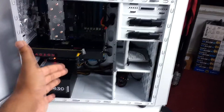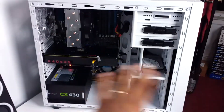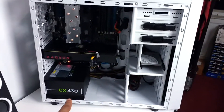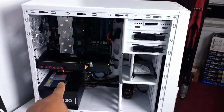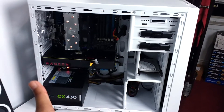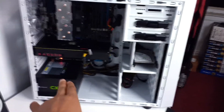From the start you could get a CX430 and run your RX 480. I tested it with full load, gaming for hours, and it didn't crash. If you have a CX430 power supply you can run a GTX 1060, a Radeon RX 480 reference version, an RX 470, RX 460, GTX 960, or GTX 970. You don't have to upgrade your power supply — you could run with a CX430 from Corsair if you have one.